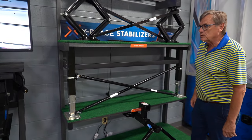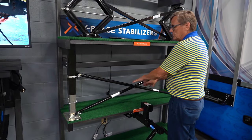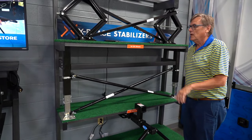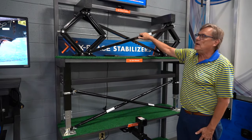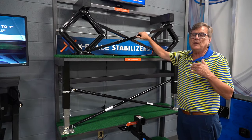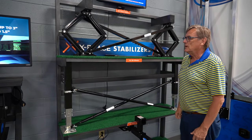And so we're going to do a test. We'll show you the difference. But it's the same concept of providing a turnbuckle design, providing lateral support, and we're just going to lock that down. What we're going to do on the rear, and this one is still under development, is take this design and put it on the very rear jack. The rear jack on a 6-point leveling is right behind the tire, so you have anywhere from 8 to 10 to 12 feet of overhang, and that's a big giant lever to move that trailer.